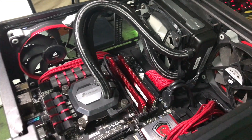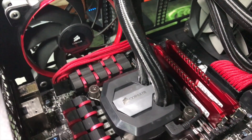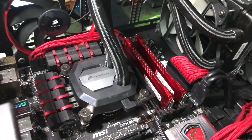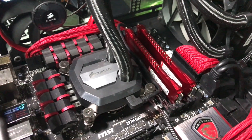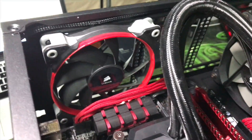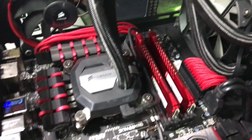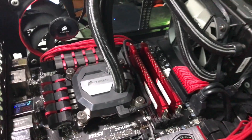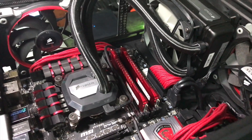All righty gang, here we are at the old Devil's Crevice — what's left of Devil's Crevice. I'm not going to do a full-on build log for this thing. I'm just going to come in with the iPhone cam from time to time and catch up on the progress as I go, and let you know what the install process is like — particularly replacing the cooler and how it all fits together. Coolers can be really, really easy or really, really kind of a pain in the ass to put in. The Hex 2.0 is apparently easy, but I'll let you know as we go. We're going to pull the old Corsair cooler, pull out those fans, probably lift the motherboard out of there to get to the back plate behind the cooler to switch that out for the new cooler. The SSDs are around the back — that's the easy part. The most fiddly part is pulling the motherboard out and replacing the cooler. So let's get to it.